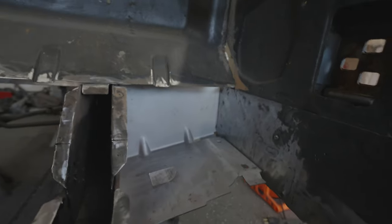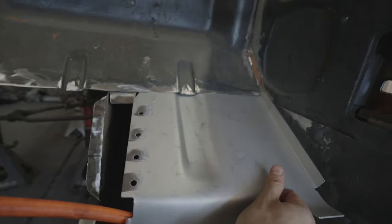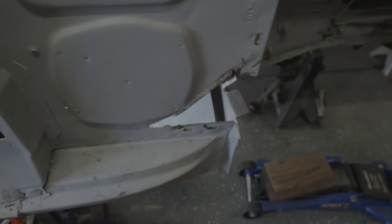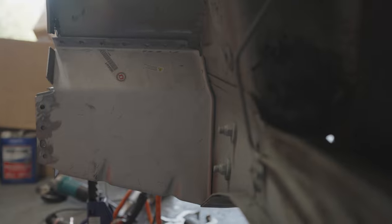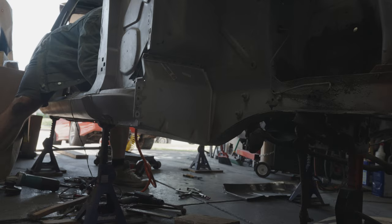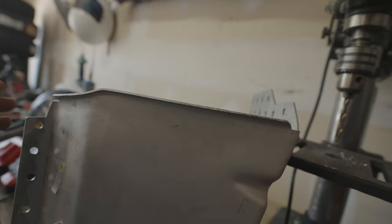I got the patch nicely blended in. The lower portion is fitting up pretty good — there are a couple bends I'll probably have to make, but now you can see why this is almost impossible to do lower-first: there's no room to slide it past the corner up top. So I have to do the top first. There's a little bit of a gap mainly because of one spot that's flared out, so I'm going to hammer that back a bit so we can bring the whole thing over just a little. It's lined up pretty well but just needs a little tweaking.